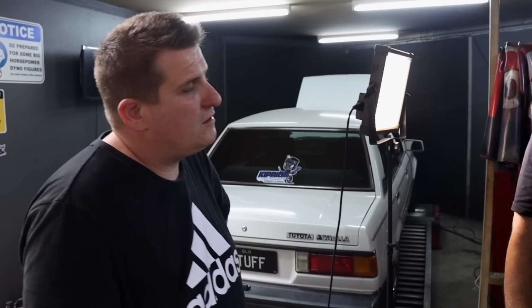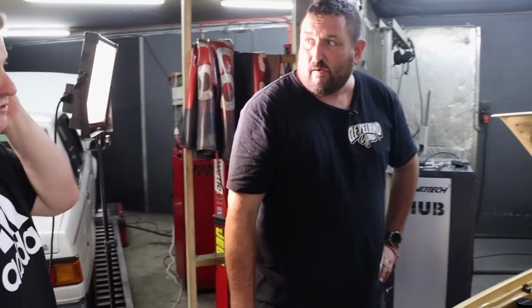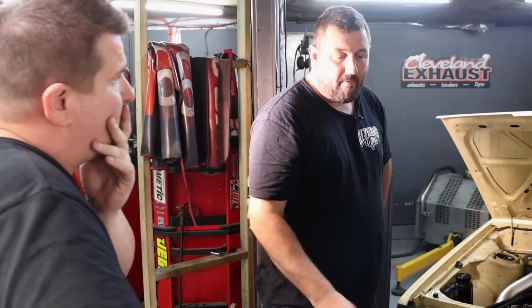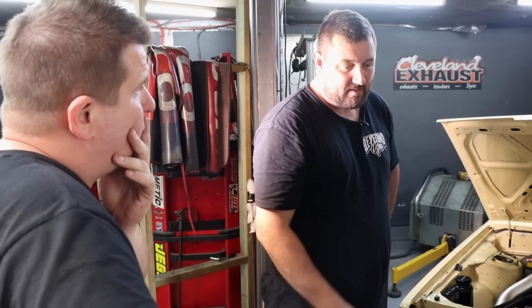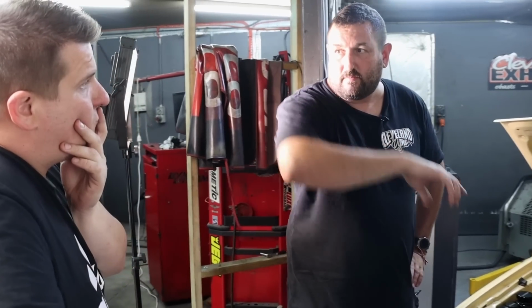Hasn't got a split hose on the feed to the top of the trailer or anything like that. Only one thing I can think of, maybe the filter's bottoming out on the bottom of the cell, because before I had no filters. I added filters. It'll run on both pumps, so I can make it. I know the pump's actually moving fuel. You've got 20-25 pound fuel pressure differential. It pulls it out, even with both pumps on.